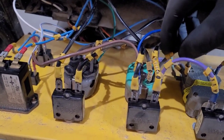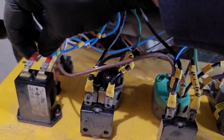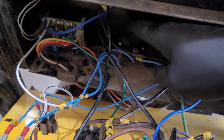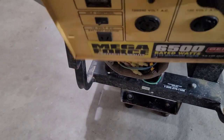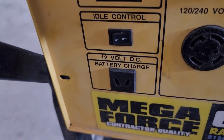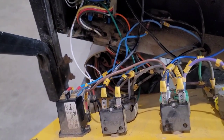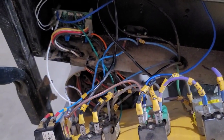I'm going to go through all these wires, tighten them up, and clean any contacts. I'll have to take off some of these Molex connectors and re-crimp them to get them tighter. Also worth mentioning: this component in the back is a 10-amp auto-reset circuit breaker for the very uncommonly used DC battery charge port. It uses a unique plug — two blades on an angle — that goes to two alligator clips. You can find them online, but I highly doubt many people use it. It's just an extra feature for charging a battery bank or similar.